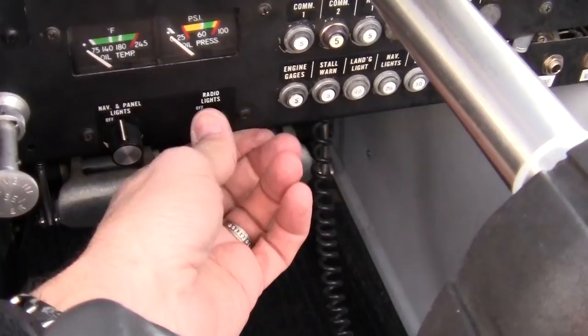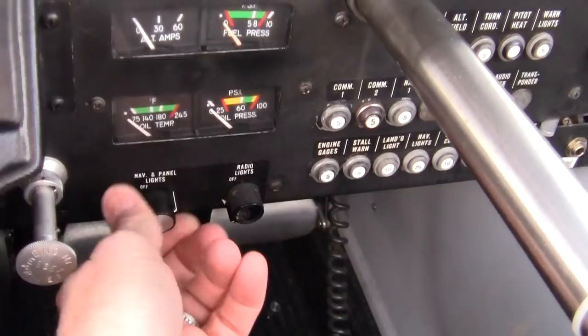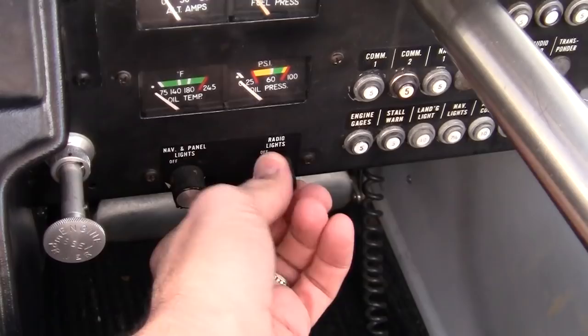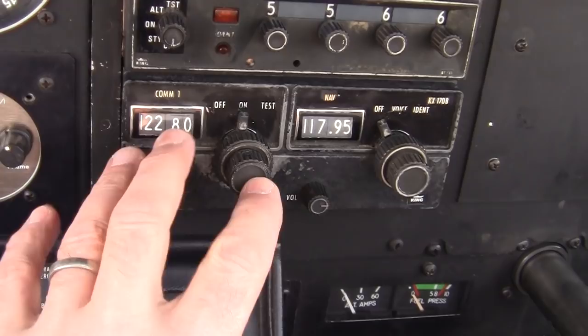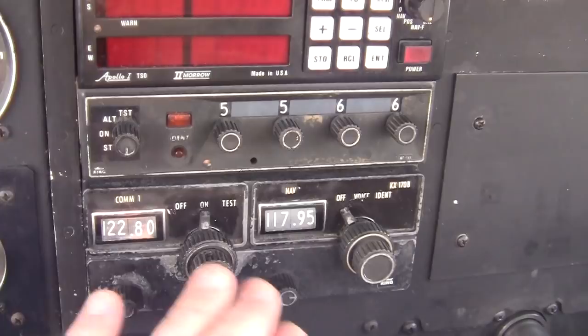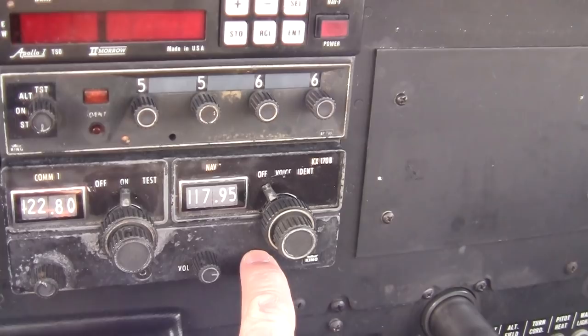Here's your nav lights and panel lights, and these are your radio lights and they're adjustable. I don't fly at night so I haven't used them too much, but these turn the red and green lights on on your starboard and port sides. Leave those off. This is the radio — we're on 122.8 unicom, it's on the ON position. You're supposed to turn it off and put it to 121.5 to check the ELT, which was just recertified. It's right there and it's in the ARM position. This is your nav side — if it's in the ON position, that will tune your VOR.